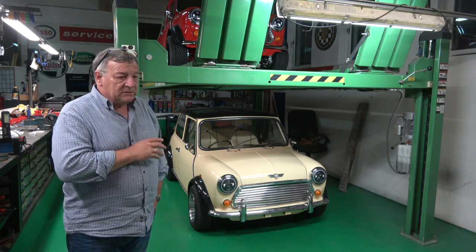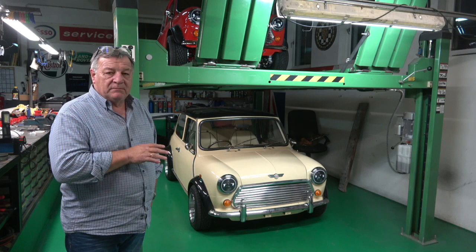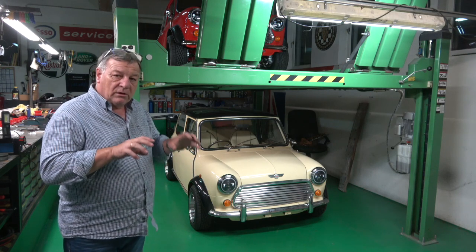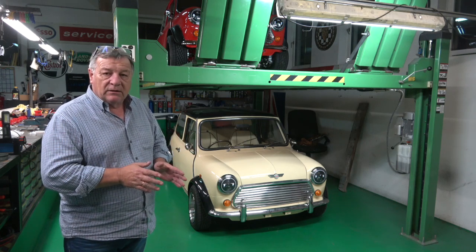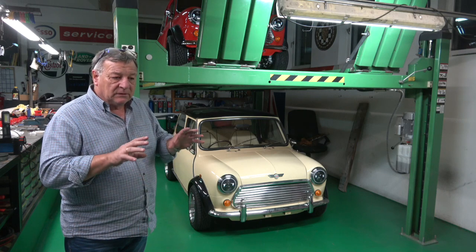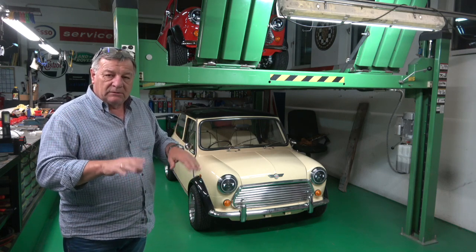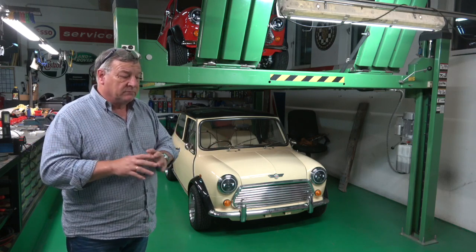The biggest problem is that although the lights look great and the beam and the brightness of them is great, there's no real light pattern to them. So when they go to do an MOT and they put them on a headlight tester, there's no pattern to the light for dip beam and the main — it's just a bar of white light. Very, very strong.